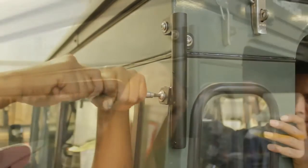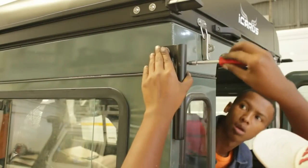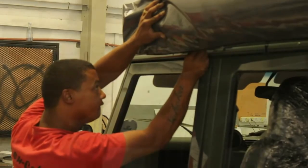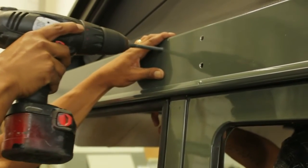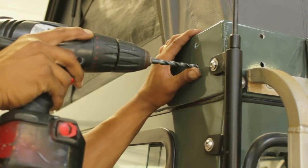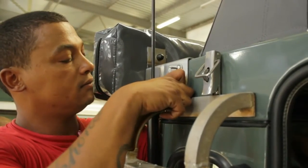At the rear end there are two helper shocks that drop into steel brackets. The bracket holes are pre-drilled on our Icarus conversion — bolt those in position and that will give you a direct indication of where you need to drill and bolt. If you wish to mount the Alucab shutter, we supply special brackets for this. Position the rear corner bracket into place, mark the holes, drill and bolt in position. Mount the back end first and you are then able to mark and drill the front end.